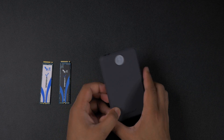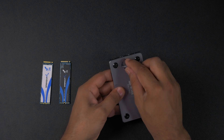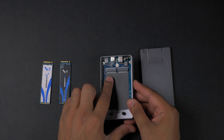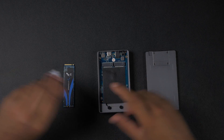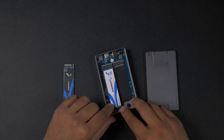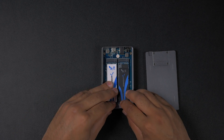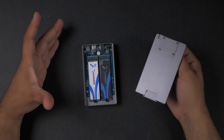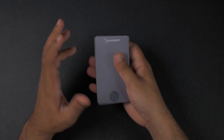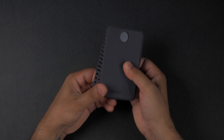To install the SSD, it is really simple. All that you do is take off the rugged enclosure and then turn it around. You can see this little metal tab just over here — you want to twist that and then open it up so it reveals the two NVMe slots. So let's go ahead and install the SSD. We'll start off by inserting the first one into the slot — and that's the first one. Let's do the second one — and there you go. Both are secure inside. Then you just grab the bottom case, pop it on the bottom, and twist to make sure it's locked into place. Put the rugged case back on, connect up to your computer, and you're ready to go.